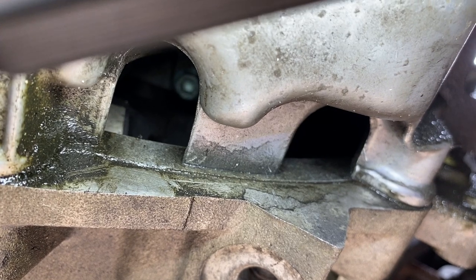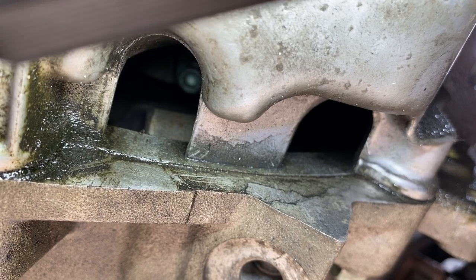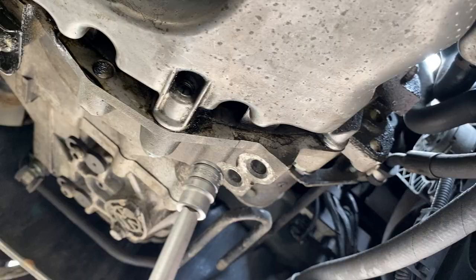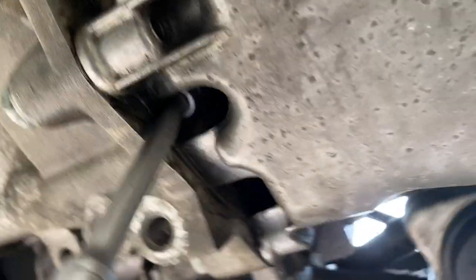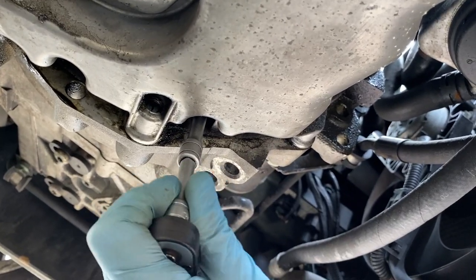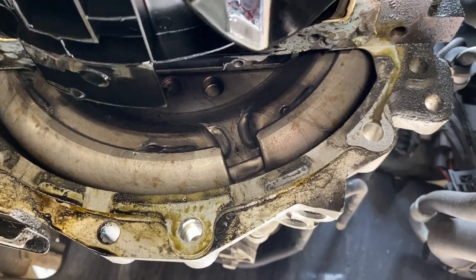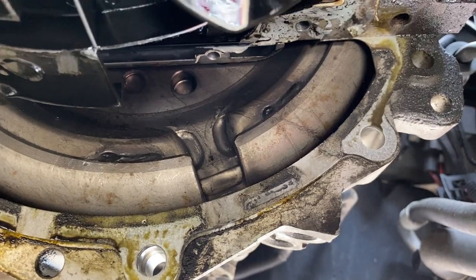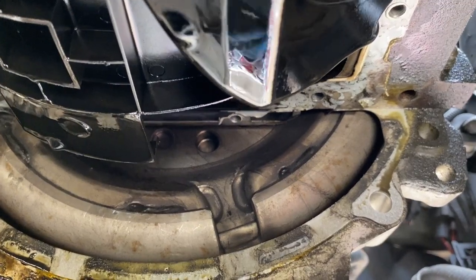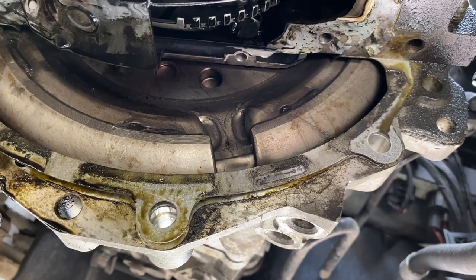Just a little bit — okay, and then back again. Okay, stop. Having taken the sump off, you can now clearly see the exact cutout in the flywheel which allows you access to that bolt. You just move the engine around a little bit until that cutout lines up with each bolt that you need to take out.